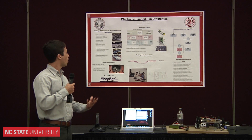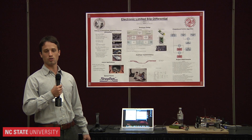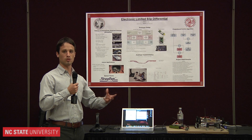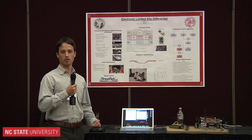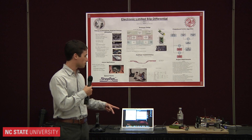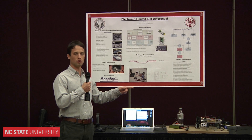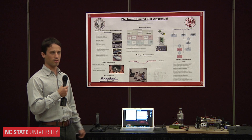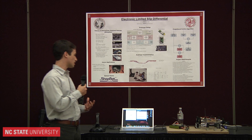Our application with the slip differential makes it more efficient. In traditional cars, there's one drive shaft and the power is distributed through a gearing system to the two wheels, and with this system you lose a lot of efficiency to non-conservative forces such as friction. With our system, we have two different wheels in a rear wheel drive setup, with one motor to each wheel, so there's no gearing system and no place to apply a mechanical differential. So what we did is we did it in software.